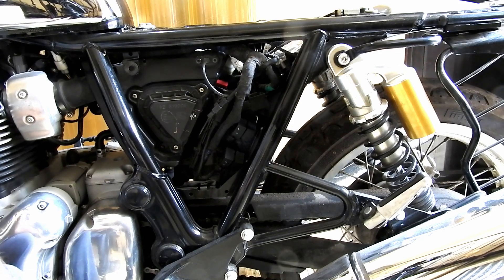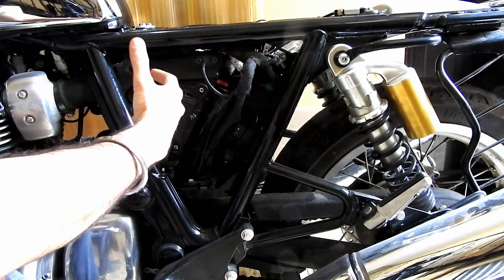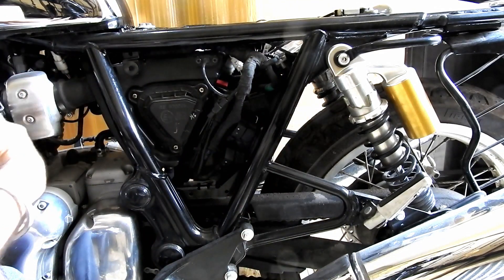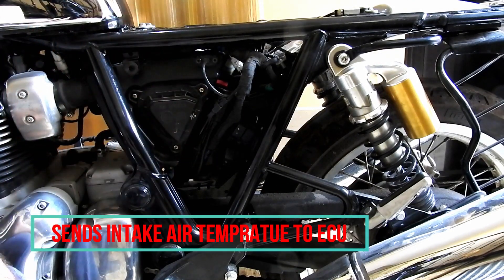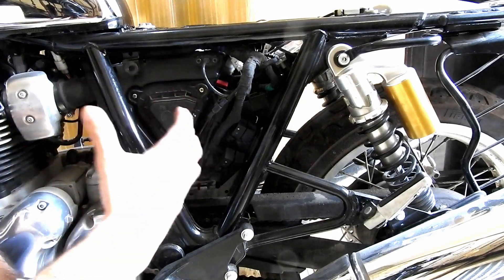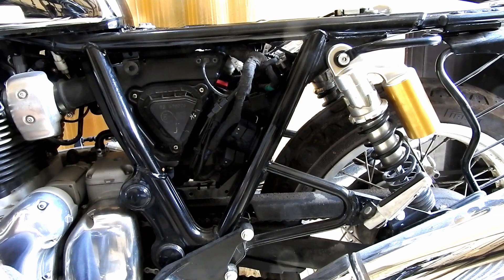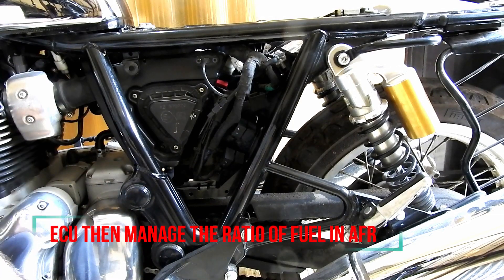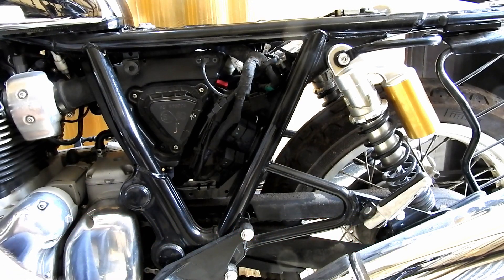So what's an IAT sensor? The IAT sensor, as the name states, is the intake air temperature sensor. It takes the temperature reading of the air entering into our motorcycle through the air box and air filter, through the throttle body, and sends that temperature reading to the ECU — the engine control unit or electronic control unit — so that it can modulate the fuel ratio in the fuel injection system to start the motorcycle in cold conditions or maintain idle when the air is very hot.